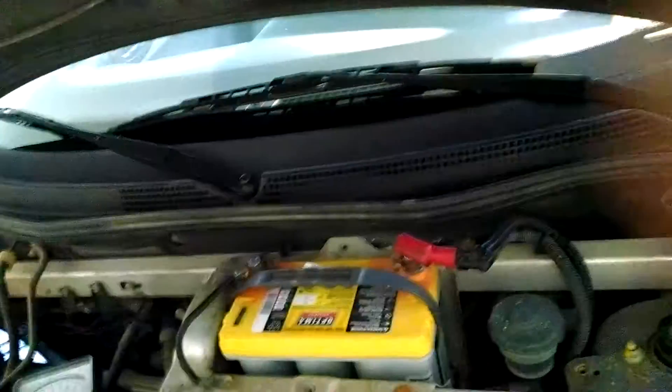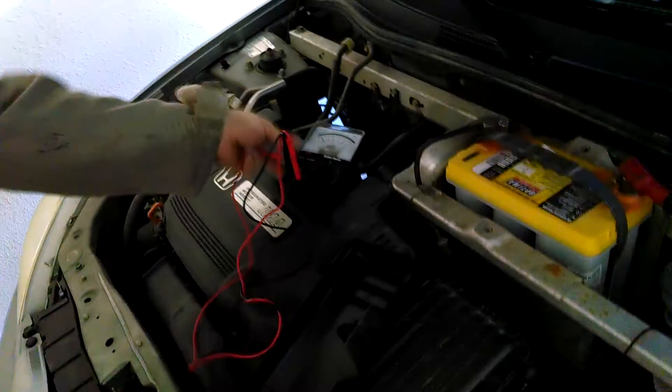It's like it just won't hold a charge. This is an LED bulb, and you can tell it's barely struggling to come on. When I turn the key, nothing. But when I go to test the battery with a voltage meter — can you hold my camera? — it says it has plenty of volts, right at 13-14. So I can't figure out why I can't get any power from the battery to anywhere inside.